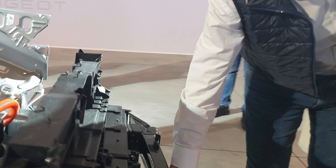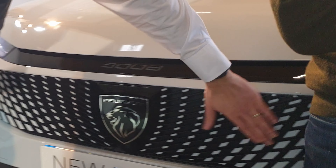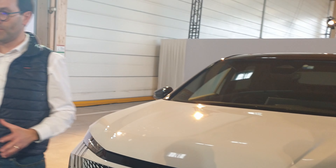Speaking about platform efficiency: the platform contributes to the overall vehicle efficiency. There is an improvement of the bearings on all four wheels to reduce rolling resistance. Also, the underside of the chassis is completely fully covered with a screen between the front and the rear to improve aero drag, contributing to the good CX of the vehicle.